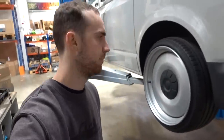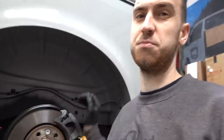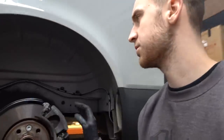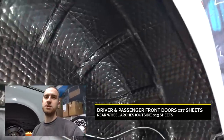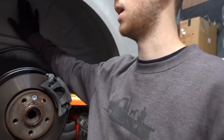The door cards and door skins are all done now. We've put the van up on the ramp, taken the wheel off, arch liner out, and we're going to sound deaden inside the arch liner. Arch liners are all removed and ready. Remember, in the arches it gets pretty dirty, so brush it down before you sound deaden, and prep spray it to get all the wax off and degrease everything. We're doing it on the outside of the arch so you can still carpet-line the inside without seeing any bumps, as it's quite hard to roll the deadening into all those angles on the inside.